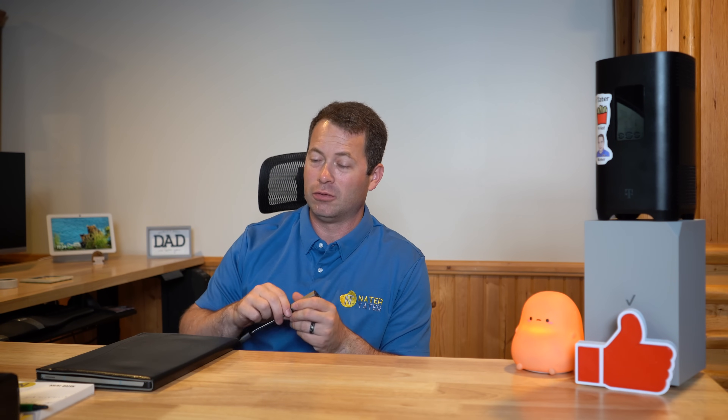Now I'm back down in my basement directly connected to the Elsys AmpliMax, not going through my Wi-Fi mesh system. I went to the third floor loft to connect directly from my device to the G4AR to avoid muddying the waters with my own system. I found that my ethernet-to-USB-C adapter is actually a bottleneck once I start getting to hundreds of megabits per second, so I'm going to use my computer with ethernet connected directly to do the speed test.